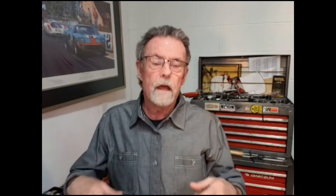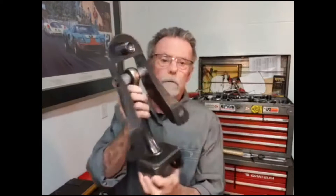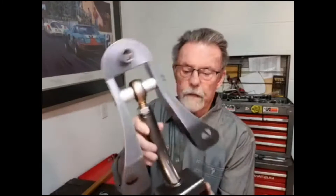The reason it works is engineering geometry. Every single piece in this package has a positive input on improving the rear suspension geometry. Starting from the top and working down, our upper control arm is pretty beefy — it's got a big three-quarter inch rod end, a real high-quality FK rod end. Because it's up high and hard to service, we put seals on it so you don't have to deal with that.